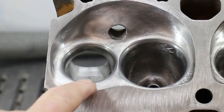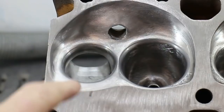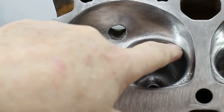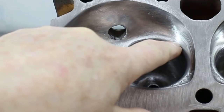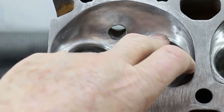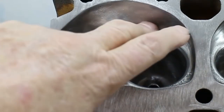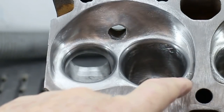The point to note here is how this turns into this here. We'll be able to see that much more clearly when I section through the head. Also note the valve seat there — you can see just how much of a turn there is above it. Now take a look at the intake: the edge of the seat here is actually a sharp edge to the chamber, that's a 30-degree cut there. So we have the radius at the bottom of the intake with a sharp edge at the top. The emphasis with the exhaust is a radius on the top because the exhaust has got to go out. Note the chamber shape — this is a virtually finished chamber shape, and this area here is still untouched; remember this is a no-go area.